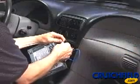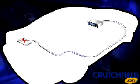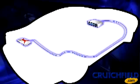While you have the receiver out of the dash, connect an amplifier turn-on lead and install it along with the signal cables. This turn-on lead will cue the amplifier to power up whenever the receiver is in operation.